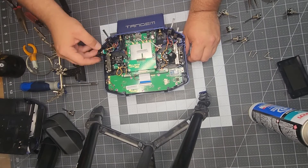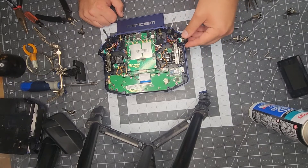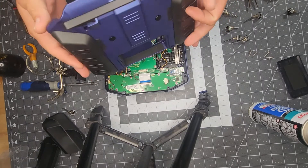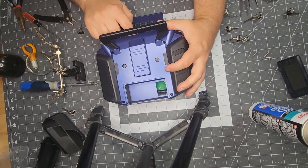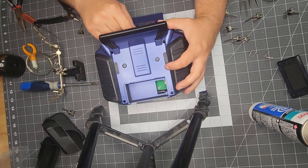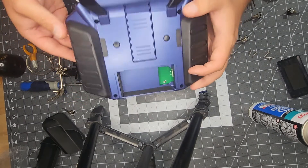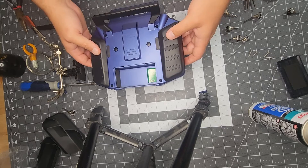We're sticking with the stock layout on this particular radio. On your sliders, wires go up — push these back into the case. There's a little channel made into the case specifically for them. We're going to need the back plate, and this is where we need to reattach that 900 megahertz antenna that we took off earlier. This is just a push connection, so make sure you get it lined up correctly. There's the 900 antenna right there — it just pushes down. If you wanted to reapply some kind of adhesive to make sure that stays put, you can — just make sure it's electronic safe.